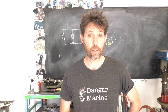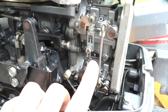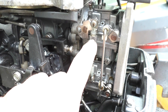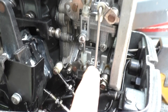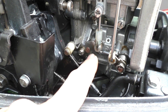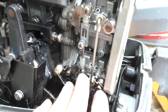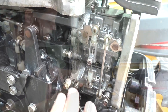So we're going to balance the carburetors and see how we go. Hopefully that'll just solve this problem altogether. There are a few different things we can adjust to do this balance. There's a screw that if we undo it allows us to change the effective length of the rod connecting the two carburetors. Each of them has their own idle stop screw, and then there's another screw that allows us to move the cam roller independent of the bottom bracket. These are all the things we'll be adjusting to get the carburetor butterfly valves fully closed at idle on both carbs evenly, and then fully open at full throttle.